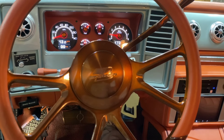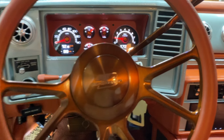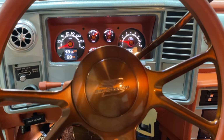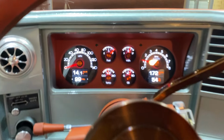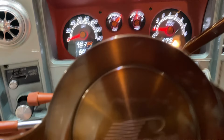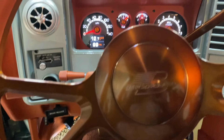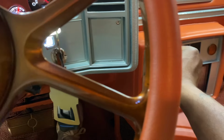Got an old school style alternator, so it ain't fully regulating until about 1500 RPM, but 1200, give or take. The idle is set at about 800, and that's where it dropped to 12.2, 3, 4. But yeah, the AC is on.